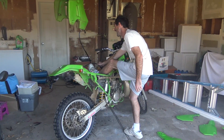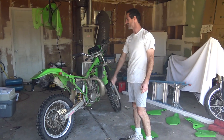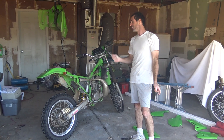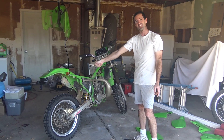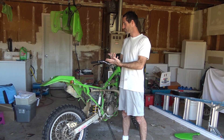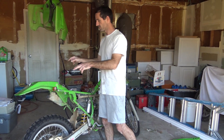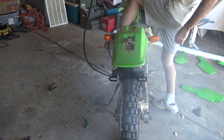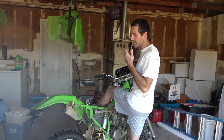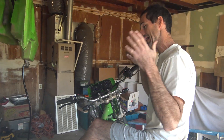I'm just as excited about this as when we got it started. Electricity is still kind of like magic to me — I don't quite understand it, and I made it do what I wanted. I'm coming down from the joy a little bit. I just thought of a couple of things: when I turn the flashers on, two of them will flash at the same time and I only checked this with one. So I want to start up the engine and see if two turn signals flash. Also, the voltage on this system — because there's no battery — may vary with engine RPM.